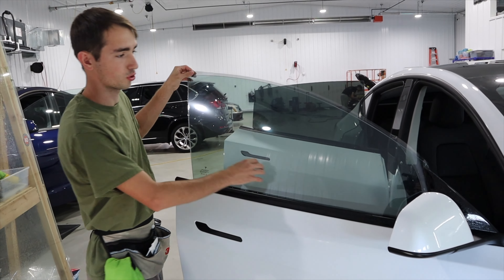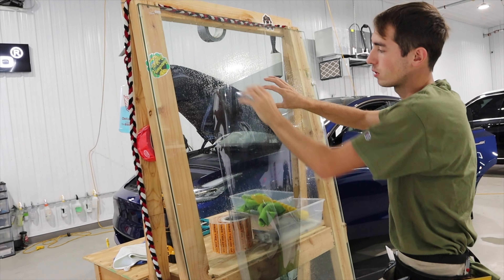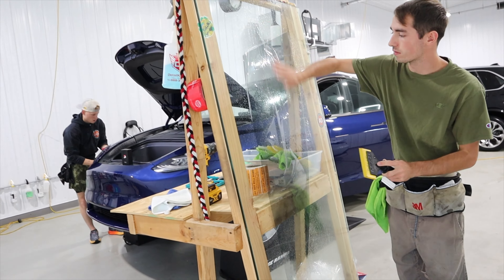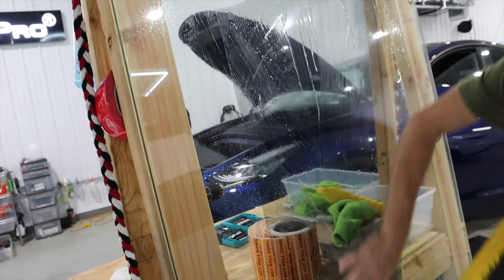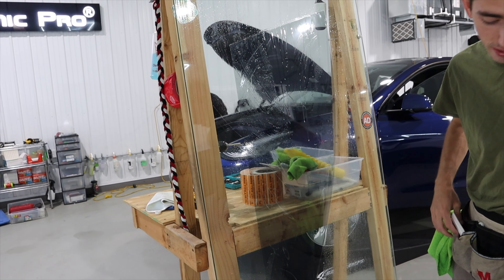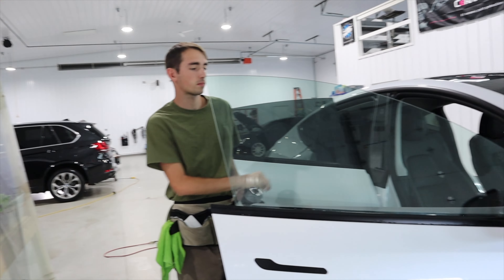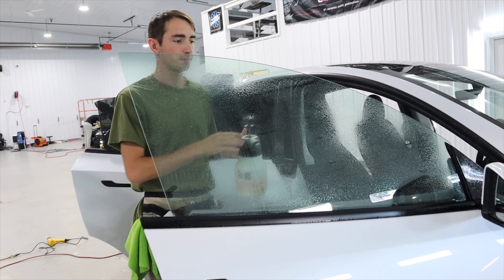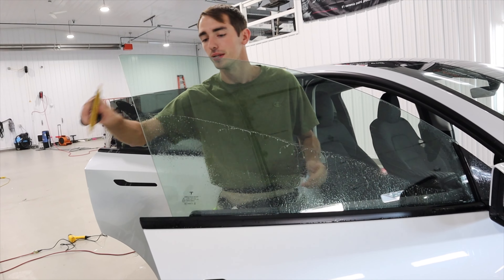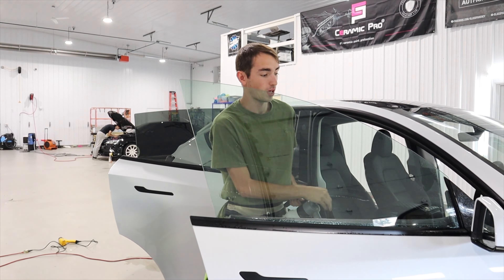A lot of tinters will actually just use the glass as a peel board. You can do that — if this vehicle was going to get coated and prepped after, I would. But I try not to, just so there are fewer water runs on the vehicle to clean up afterwards. So I just put it on the peel board. Now that we've shrunk it, the film won't sit flat on your peel board, so don't try to squeegee it perfect because it will likely end up creasing it. Even though we just prepped the glass, we actually want to do what we call a spray-squeegee-spray — it'll get any dust or lint that's fallen on it in the last five minutes. It's really just an insurance thing to make sure nothing's on the glass.